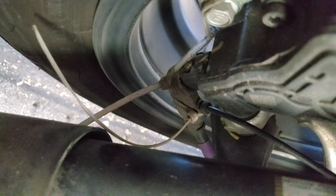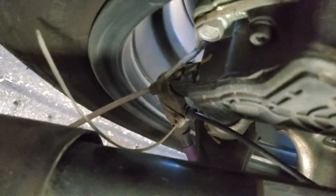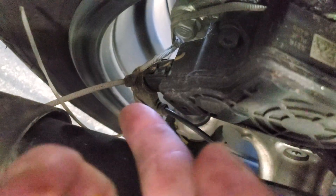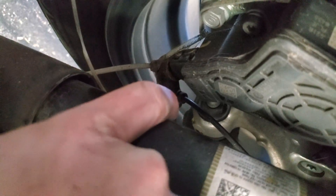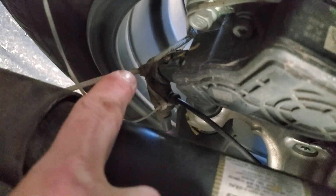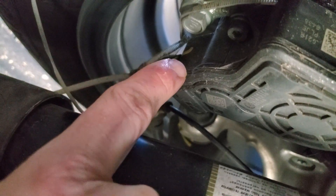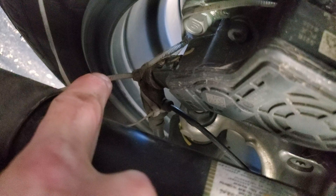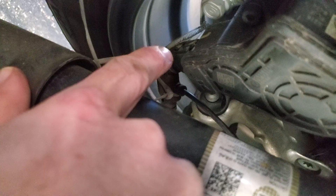This connector has a boot, and you can see I've zip tied it. The wire comes in and connects on this black plastic housing here. If you wiggle this boot you'll notice it cuts off. What I did is I did one zip tie around the wire, took a zip tie around that zip tie, and then came up to the top and zip tied it to kind of push the connection onto this black housing on this rear brake. This was the worst of the two — at first for the first couple months I just had this one, then the other side started acting up.